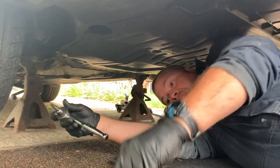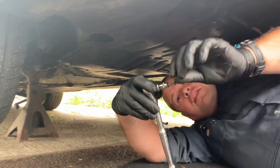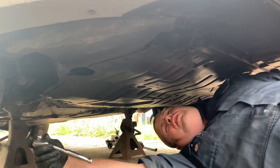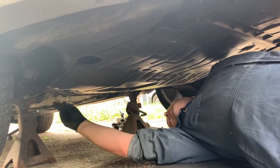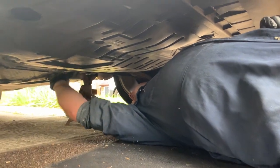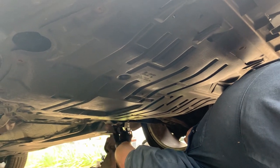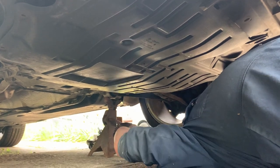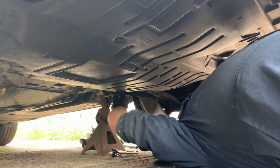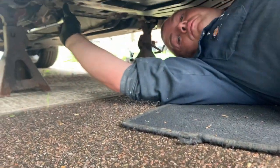So there are six TX20s, and now there's three TX45s. These are just cheap ones I got off eBay, maybe off an auto jumble. There are three of these — you won't have trouble with these because they are actually proper bolts going into aluminium. I've placed the axle stands on what they call the subframe bushes.